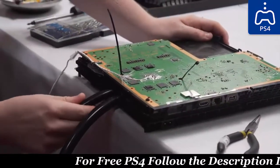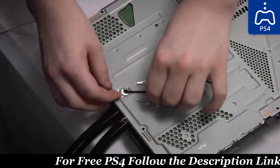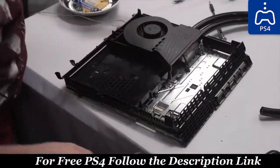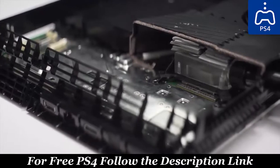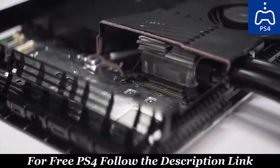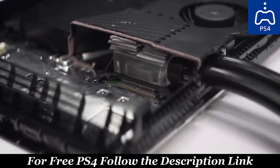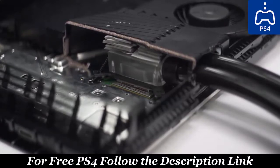With the tubes installed, it was time to reassemble the PS4, but we needed to make sure our block was securely mounted first. That single zap strap didn't really seem to cut it. But with four or five pieces of squishy double-sided tape, we were able to compress the stacks, slide them in and let them expand, giving us a surprisingly good mounting solution that not only held the block in place but also supplied adequate pressure between the block and the APU.